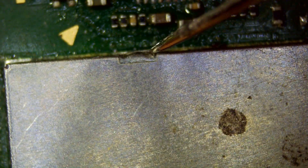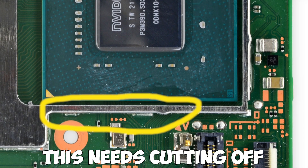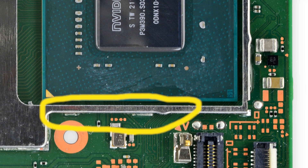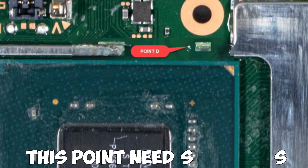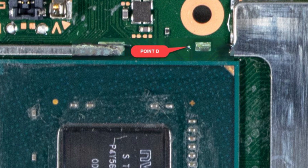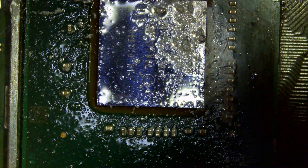Get a needle and stick it in the CPU heat shield edging, then slightly bend out the tabs so the cover will come off. The switch OLED I'm using was from a previous repair — a failed mod — so the heat shield had already been cut. What you need to do is carefully get some wire snips and cut the section I've circled. There's also a trace that needs scraping away slightly, as we'll need to solder to it. Then remove all the thermal paste and lay down the first cable.